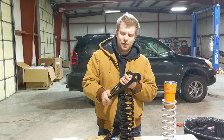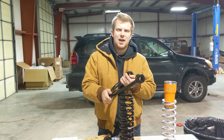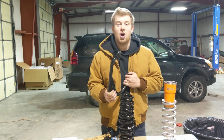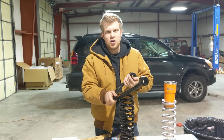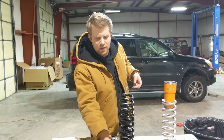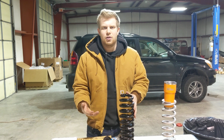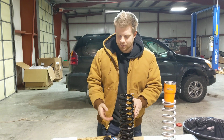While your previous full droop location was here with factory options, when you put that spacer in and it pushes everything down, your upper control arm needs to be able to accommodate the extra droop that your lower control arm is seeing. And what happens is, on OEM control arms, you hit a bump and your suspension goes to unload, you hit your coil bucket with your upper control arm. That is very loud, it's annoying, and it puts extra wear and tear on your suspension. And in extreme cases, we have seen catastrophic failure of OEM upper control arms because of the repeated bashing of the coil bucket by the upper control arm.